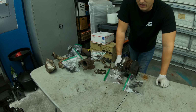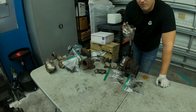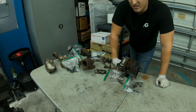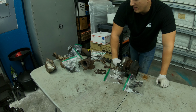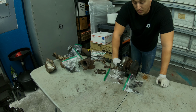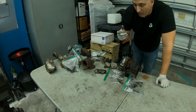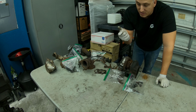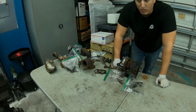So what I used, of course, is my mainline stuff, the Snap-on stuff, which is the high quality tool. And I think that's what the difference was between taking off the heat shielding on the rusted bolts and having those bolts actually snap or get stripped, versus some cheaper tools. So I will say that was a huge plus if you're going to do this job. Nicer mainline tools are a plus just because they're tight fitting and grip that bolt. And if you saw, I was using my impact gun slowly, not just pulling the trigger and having it come off, just tapping the trigger, putting some pressure on that bolt, persuading it to come out slowly.